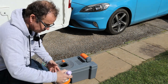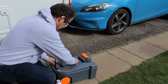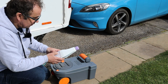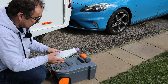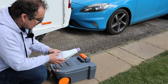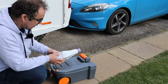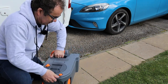There's the five litres — close that off again and put the flap back down. The instructions say to shake the closed waste holding tank several times to thoroughly wet the inside surfaces, and let it stand for at least 16 hours. A tip: driving with the cassette tank cleaner in the waste holding tank will improve cleaning performance — that's probably more for motor homes. Carefully vent internal pressure before opening the blade, always empty into a designated location, then rinse thoroughly with clean water. So basically I need to give it a shake now.